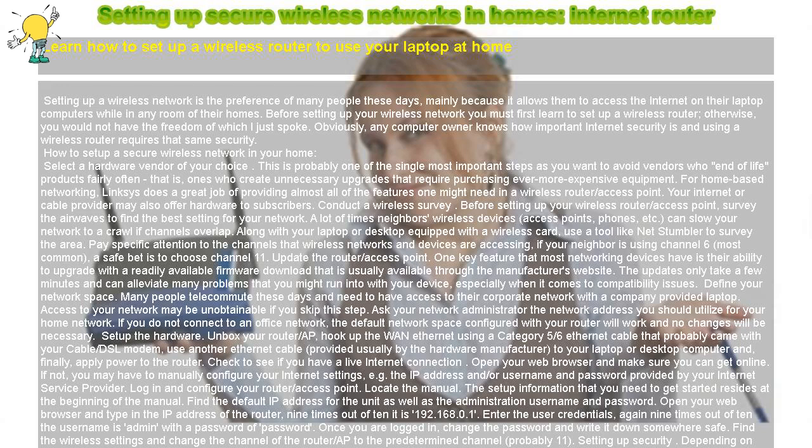Again, find the wireless settings and point to security. You will have the option of selecting the encryption type and a passphrase. Use the most cryptic string of characters that you can stand and, again, write this down somewhere safe. Also, a good rule is to type it into a text file so you can copy/paste it into your connection string when you connect. This also comes in handy for guests who need to access the network. Save your changes and disconnect from the router/AP.